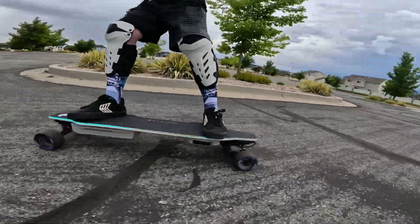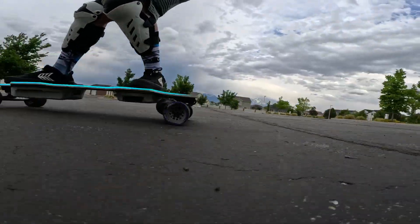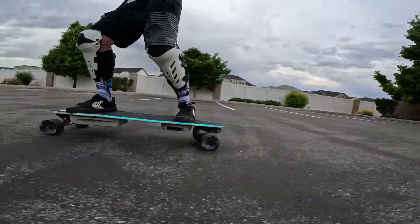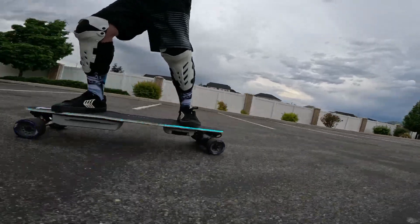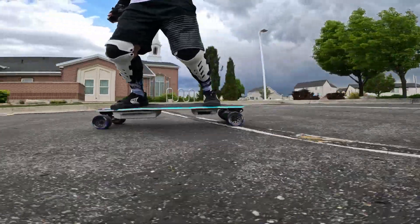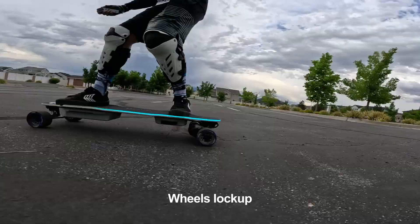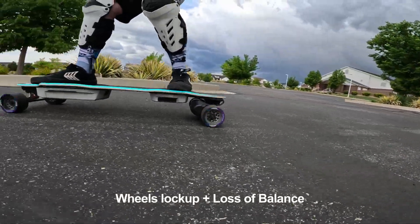Overall, this is super dangerous because it's entirely possible for the board to lose control in wet or unfavorable road conditions, causing the rider to lose balance and fall. Backfire engineers have replied to me on this braking behavior — they are aware of this issue and are looking into it. So far, the only solution is to just not brake very hard and not turn the knob all the way back, and practice braking as hard as you can without triggering the lockup. These are your only options. This shouldn't be happening on a $1,200 premium electric skateboard. If you or your friend have a Zealot X, you need to let them know about this, because if an emergency comes up and you unknowingly apply full brakes, you may lose control of your board as it locks up, leading to serious injury. However, I think this issue is easily avoidable if you simply know about the problem and learn to control your braking curve. Hopefully Backfire will release a firmware update to fix it.